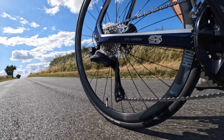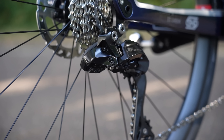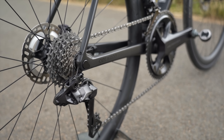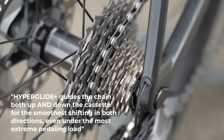When you dive into the differences in a bit more detail, you really start to notice the distinction between the two group sets. The first subtle difference is in shifting speed. Both have improvements in shifting responsiveness and rear shifting on both bikes is fantastic. I'm led to believe they have the same motor technology in each rear mech, so shifting speed up and down the cassette is absolutely fantastically fast. We don't have Hyperglide Plus on the 105 cassette, which you do have on Ultegra, but I can't really feel the difference — it's very minimal, if any at all.